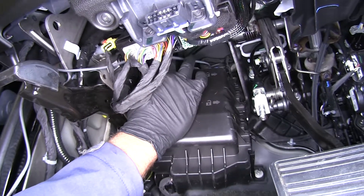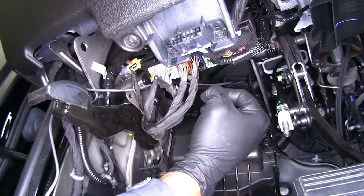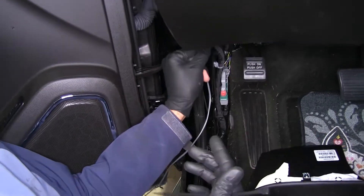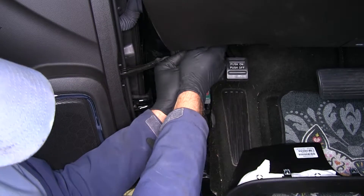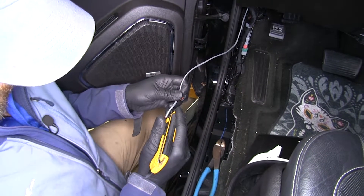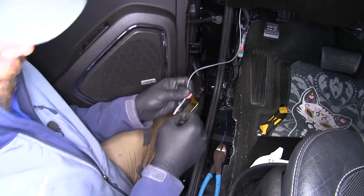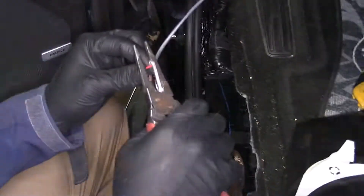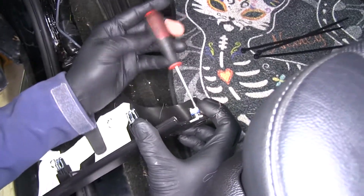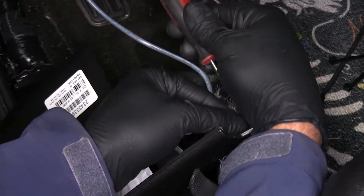Up here where our wire has come out — the grommet is located right behind this box, so you'll have to reach in behind there to find it and pull it on up. Bring the wire through with a little bit of excess so that if someone takes that panel off they're not going to rip the wires out of our switch. Zip tie it off right up here to the wire loom. Now we need to separate the jacketing off the end of our wire — there are two wires located inside. Just cut that outside portion; you don't want to actually cut your wires. Strip the end of each one back. On the back of our switch we've got two Phillips screws — back both of those out, place our wires in, and tighten those back up to make a good connection. No need to over-tighten them.